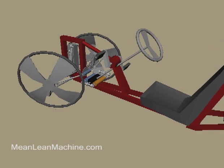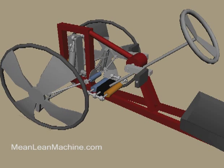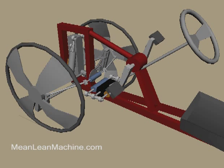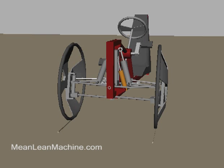This trike will use a system of hydraulic valves and actuators to allow three different modes of steering. Actuators acting as pumps in dual closed hydraulic circuits are driven by a rack and pinion connected to the steering wheel. The three modes are: normal steering, counter steering, and free caster.